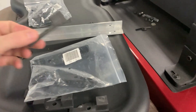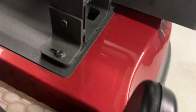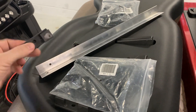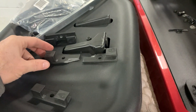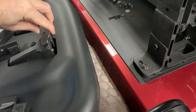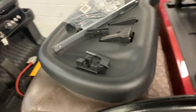What I'm going to do today is take a little bit of angled aluminum, shave down this little lip, and stick it here — it will be able to fit. With that extra support, hopefully I won't break them again. I'm going to cut a piece of this, drill it, and put the bottom against my grinder wheel to flatten it out. That way, hopefully we'll avoid breaking these guys off. I had switched them at one point over the summer, and I moved them so there was a clip, and now the other side broke too. So I've got two broken ones and I think we need some extra support.